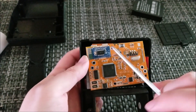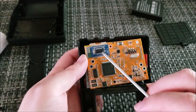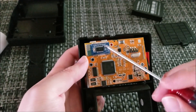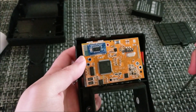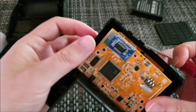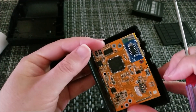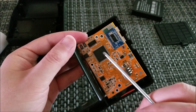The Bluetooth and Wi-Fi module looks like an off-the-shelf module similar to an HC-05, though it will have custom firmware. There are only about eleven pins in use, suggesting a serial protocol with something like an AT command set to send and receive data. There's also an ARM processor — not a small one — which is the main chip handling all functionality, driving the motor and the thermal head.